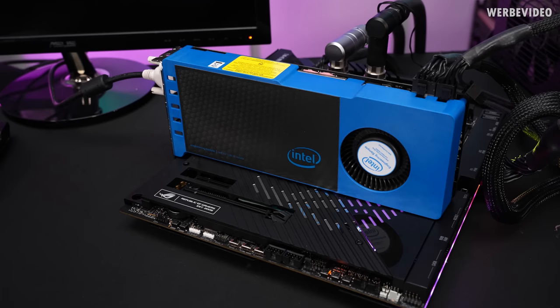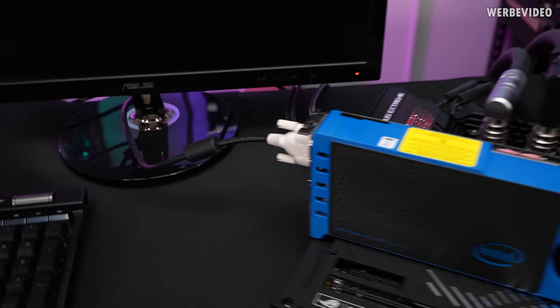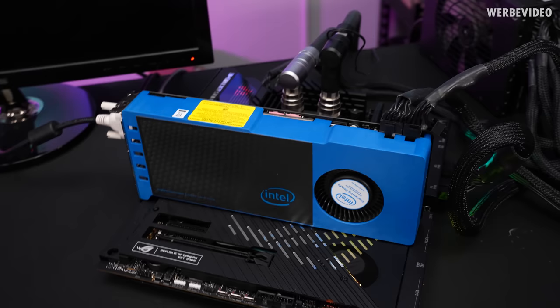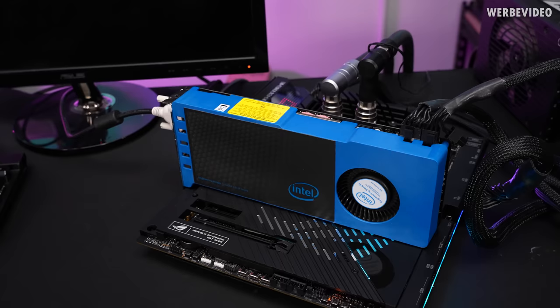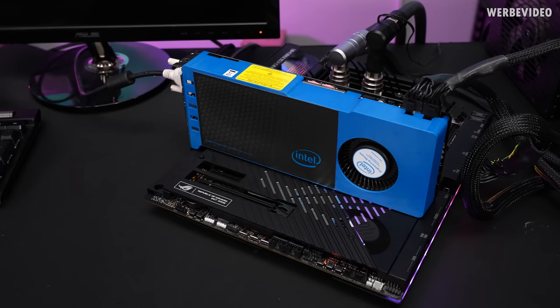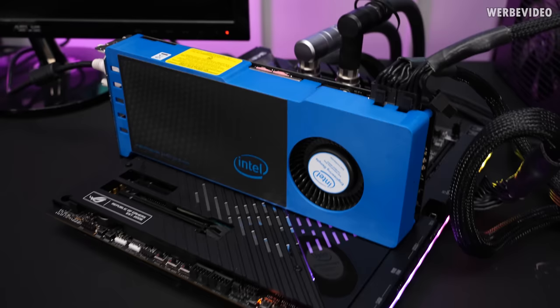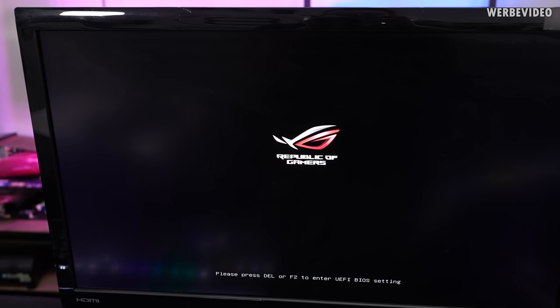I already tried using this Larrabee card with my other monitor via DisplayPort and HDMI, but none of them worked. I asked the previous owner how he got it to work and he said he used native DVI with a legacy monitor. I also had a 3080 plugged in first to change BIOS settings such as disabling fast boot and setting a post interval delay of 10 seconds, giving the card enough time to boot the OS sitting on it.